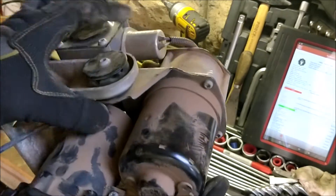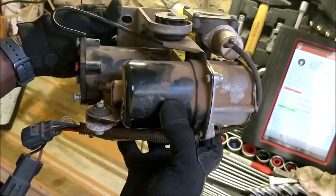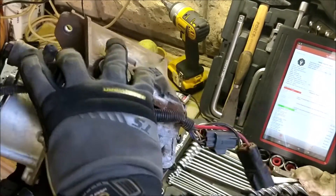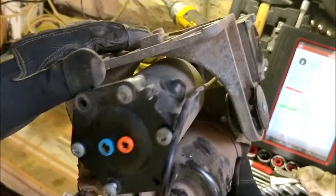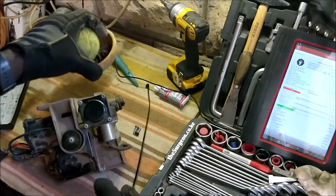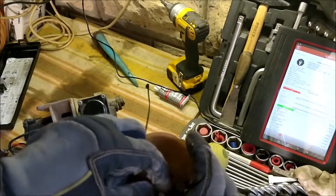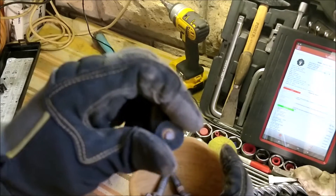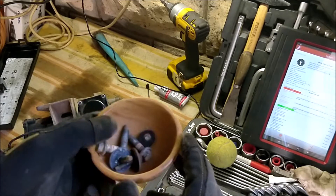It sits in front of the rear left wheel, sitting like this as you can see. Thank you UK for all the rust and corrosion. It's held in place by three 10mm bolts, and because of all the corrosion, one of them has snapped. The plastic cover comes off, held by this clip — it snapped too, but we'll take care of that later.